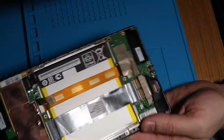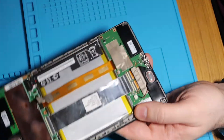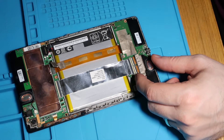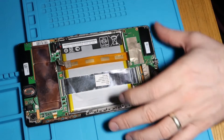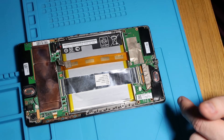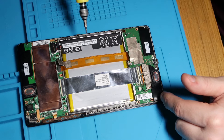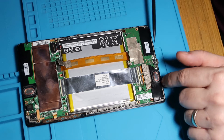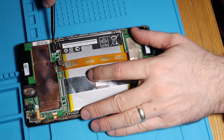So we'll pop the bottom case to one side. I haven't sealed it back up from when we did the previous repair. If you want to see how to do the port or how to back off, look in my previous video and I'll try and link it at the top of this one for you. So first thing we're going to do, we'll get this battery out and disconnect it. We'll get the charge port out again and we'll disconnect these speakers. Hopefully this will work so we're going to have to give it a bit of a test.